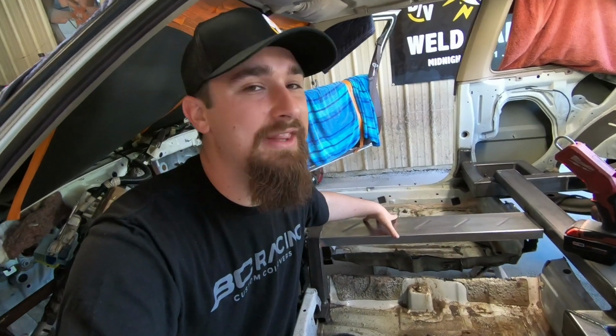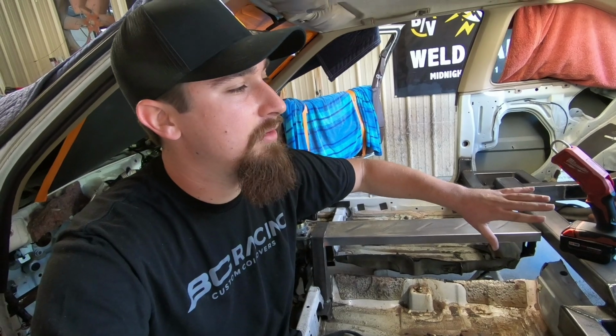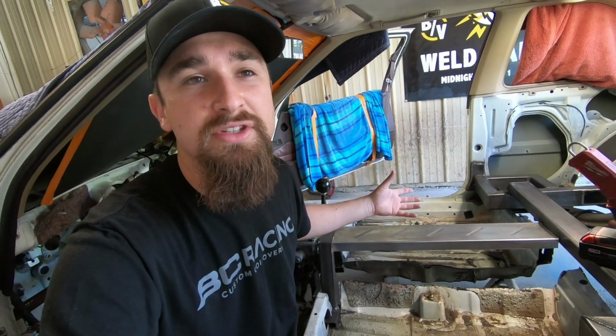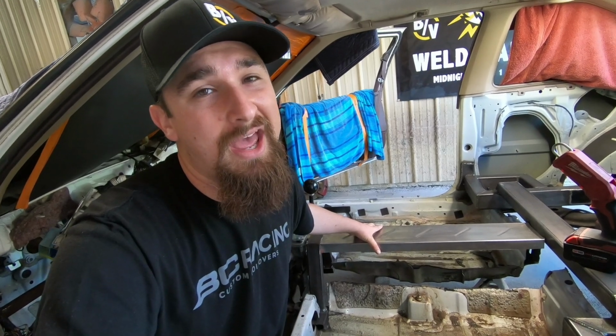Anyway, so you can use a lighter metal that's just as strong as a thicker metal, and we've already added quite a bit of weight to the car. Now this isn't really really structural, even though it does add structure. This is more filling in the gaps and closing everything in. So this looks really good. The bead rolls look really good, and they add strength as well.